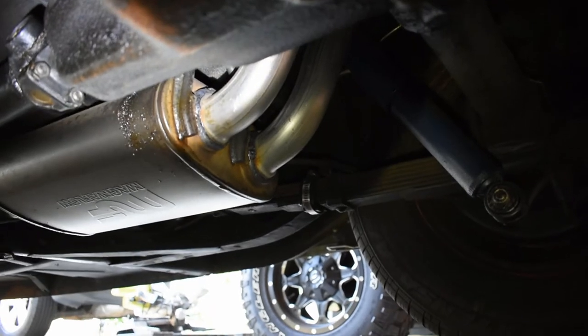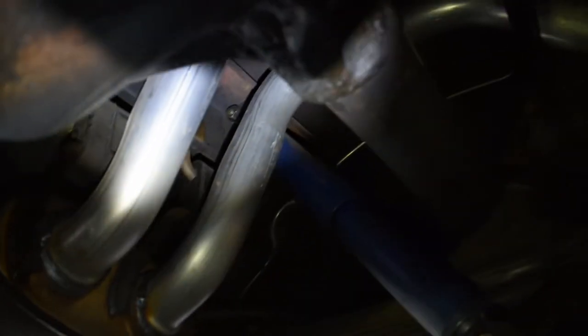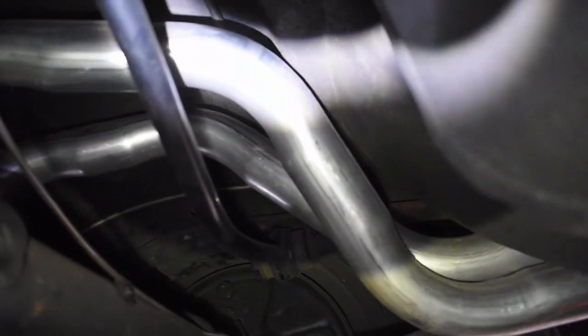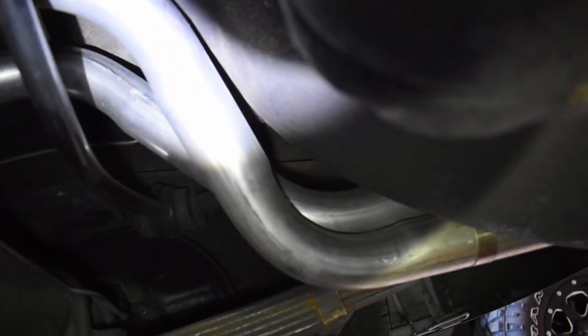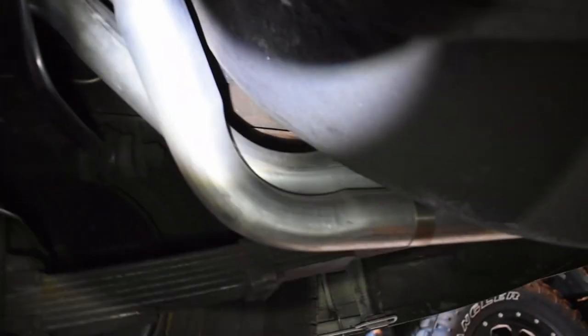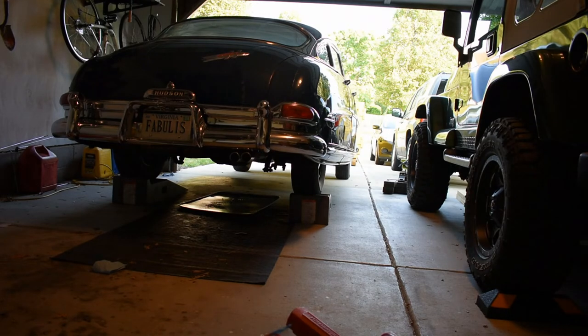Here's another view from the other side of the car — I have a light so I can show you a little bit better. Here are the two pipes leaving the muffler, jumping up over top of the axle and over top of the panhard rod, any brake lines or wires, and then right back down almost immediately behind the panhard rod, then underneath and beside the spare tire well. That's the magic bending right there, and then pretty much straight back to the back of the car where they lay flat again. She's a little cold, haven't warmed her up yet, but it's about 100 degrees outside here in Virginia, so I think she'll start up without complaints.